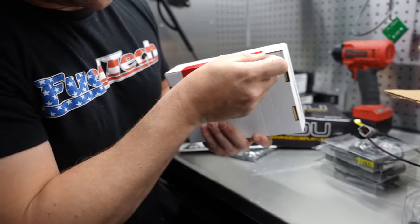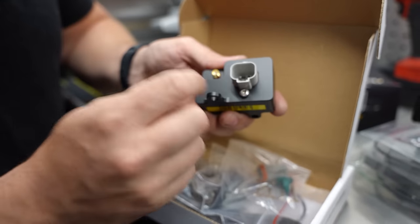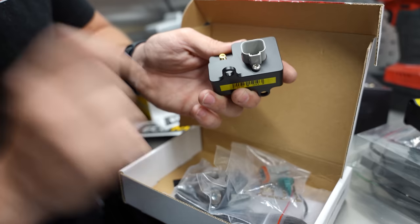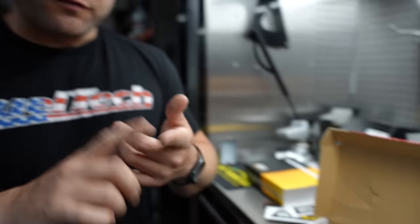So I don't know if I'm supposed to show you guys this, but I will anyway. A GPS CAN module. This one is different than Haltech's. Now Haltech's is wonderful for speed. Haltech's unit gives pulses for every unit of velocity that I'm going. If you go 1 mile, it's basically measuring distance. It does 5,000 pulses in like a kilometer, and a mile is 1.8 or something like that. So there's a certain number of pulses per distance. You can figure out number of pulses, speed, all that sort of stuff. It's a derivative of that.